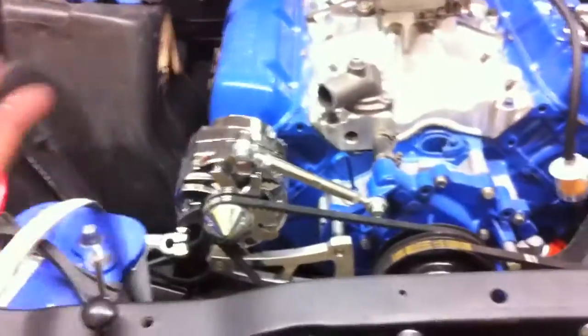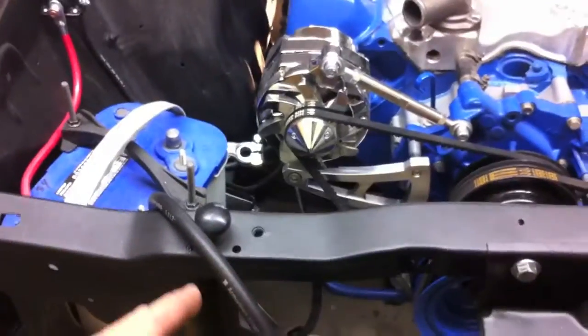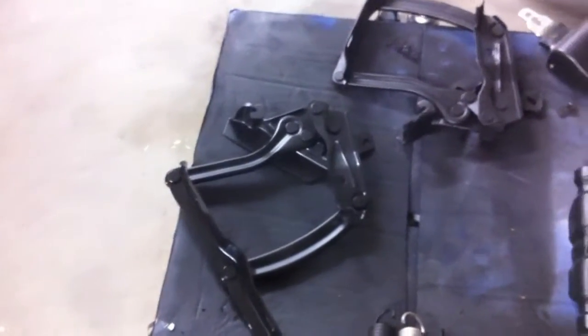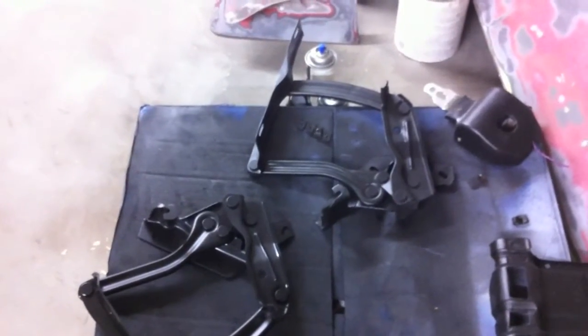All right, you're a Mustang Medic. So all those lines are set up — here's that line coming all the way through and up and out; it awaits the radiator. Ricky smiles every time I say radiator. The built-in trans cooler — we pray it's on the passenger side, but either way we'll run the lines up and under, no issues. Now we're going to focus on hinges, doing our spring thing we did before. We also need to check with Rick about those bolts to see if I have the right threads to put the seat belts on.